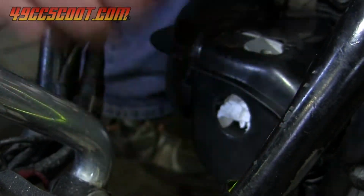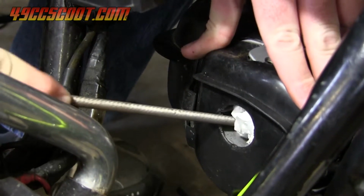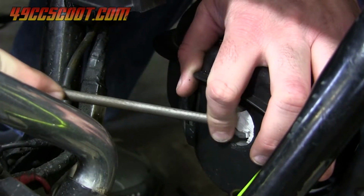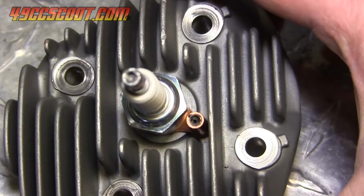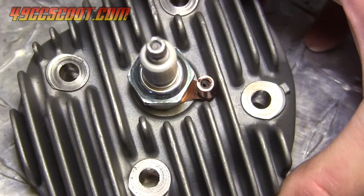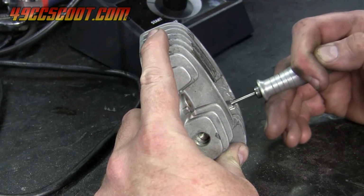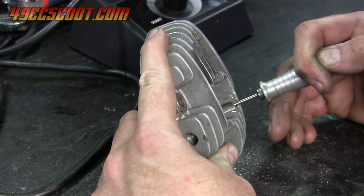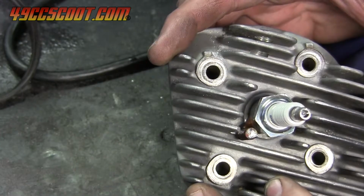Make sure you cover the spark plug hole if you do this without removing the shroud to prevent debris from getting into your engine. Then a file, rotary tool, or razor can be used to make a cutout. Sometimes the fins on air-cooled heads also get in the way of the sensor, not letting it seat against the head properly without bending, or causing difficulty installing the plug. In those cases, I use a rotary tool and carbide burr to take off just enough of the cooling fin to get a good fit with a little room for movement of the sensor. This can be done with the head installed, but the spark plug hole must be blocked off during the cutting.